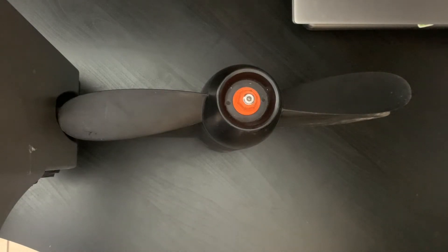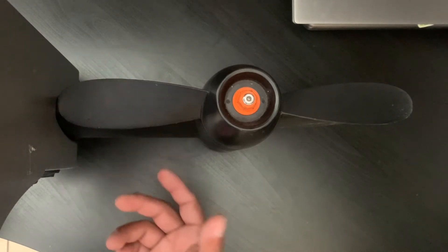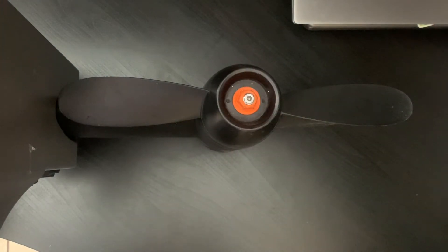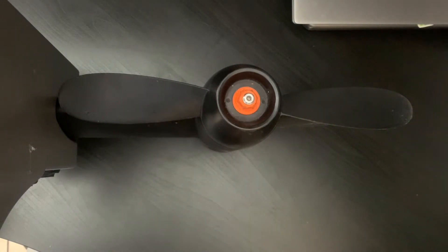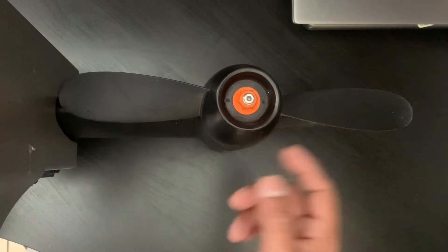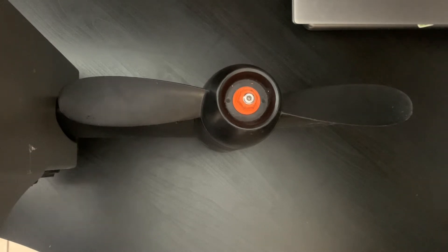That is an easy replacement of the propeller. It is a pain in the butt, but I'm going to be ordering another one here real soon to keep in my kayak just in case. If this propeller cracks or breaks an ear off while I'm super far out on a bigger lake, I don't have to paddle back with a hand paddle. When doing a replacement out on the water, make sure you're holding on to the nut and the shear pin — you don't want to lose anything. Probably best to bank off somewhere, pull the PDL drive completely out of your kayak, replace it, then put it back in and get on your way.